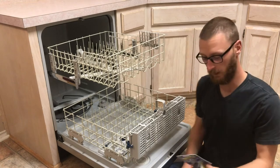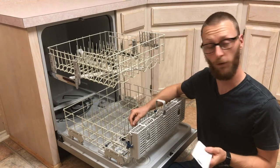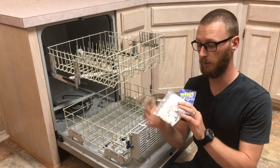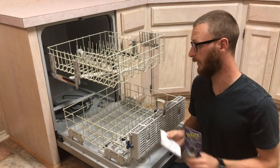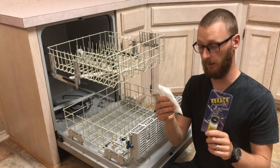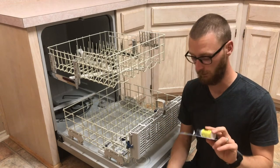So what I'm going to do is I've got a product here by Plasti Dip. Other companies make similar products, but it's a coating that you can go over and re-coat these tines. What I wanted to show you is that you can use this in conjunction with these little plastic caps that some people use. Often these are sold just to cap each tine, and this is sold to re-coat it. But if you use the re-coating to cover all the rust spots and then cap it with these plastic caps using the re-coat as a covering and a glue, it holds up much better. I'll put links in the description box below to both of these products.